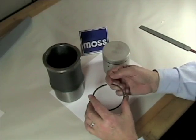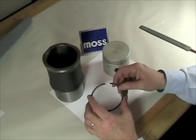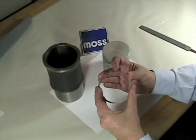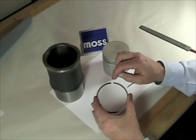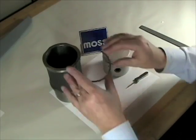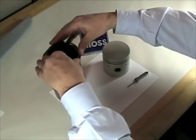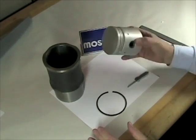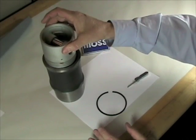As you look at this ring, there's a gap right here where my finger is going through. When this is inside the cylinder and it's made smaller, that gap is very, very small. We need to know just how big that gap is. The way to do it is you squeeze the ring, get it down inside so it's roughly in there like that, then take a piston and turn it upside down and push down.